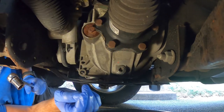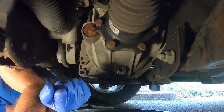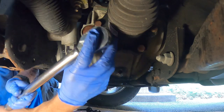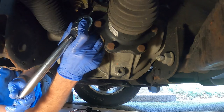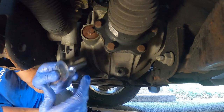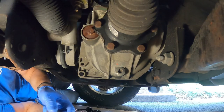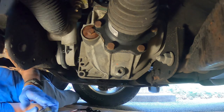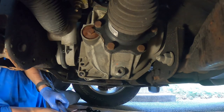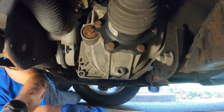We're at 24 foot-pounds for the fill and drain plugs, and on the rear diff as well. I'll grab the torque wrench and get those nailed down. Got it set to 24 foot-pounds — looks like we're already there on the fill plug. I need an extension for one, so I'll do the drain first. We're already there — see, it does not take much. So we'll put our cover back on, the brush guard, and be done with this one.